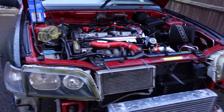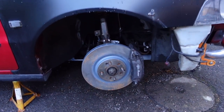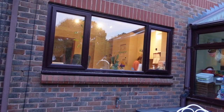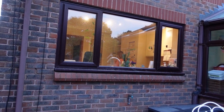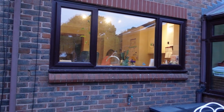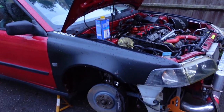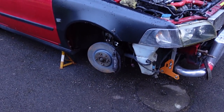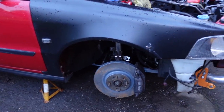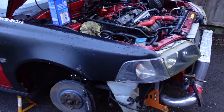We are ready to bleed — I've got some brake fluid and this side is ready to go. All I need is my assistant who is unknowingly in the kitchen. No pressure bleeder here; we're going to do it the old-fashioned way — she'll press the pedal and I'll let the pressure out of the bleed nipples. It should only take a couple of minutes.